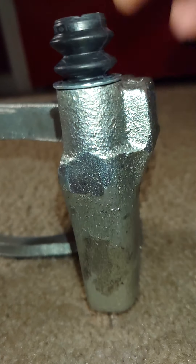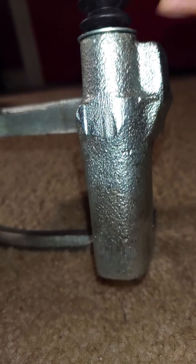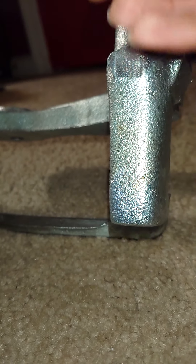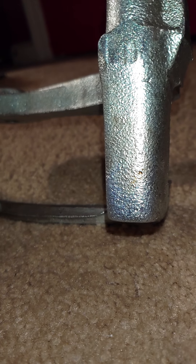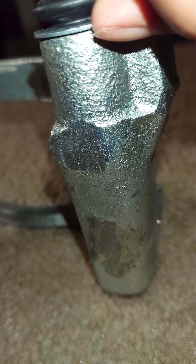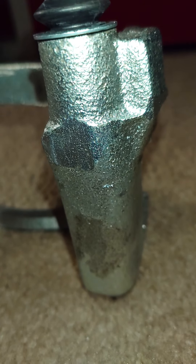The purpose of these boots is to actually keep contaminants away from the sliding guide's crevice in here. That way, gunk doesn't get in and clog up the sliding pins. That's why it's very important to have a uniform gap — or as minimal a gap as possible — around, so water doesn't get in there.